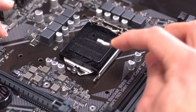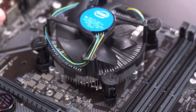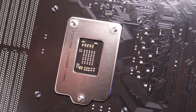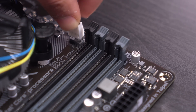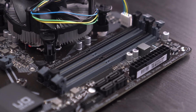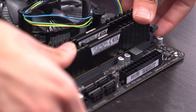Get the lever under the screw and push it all the way down to lock the CPU in. Now for the stock cooler — line up the four mounting points with the four points on the motherboard. The thermal paste is already pre-applied, so don't worry about that. Once lined up, press down on opposite sides first, then the other two. You should hear it click. It should look secure on the back of the board. Hook up the fan connector to the CPU fan header on the motherboard, which is labeled 'CPU fan' right by the RAM slots. Now let's get our 16GB of RAM in — pull back the levers on the second and fourth slots, line up the RAM stick, and push down on both sides with your thumbs until the levers click.